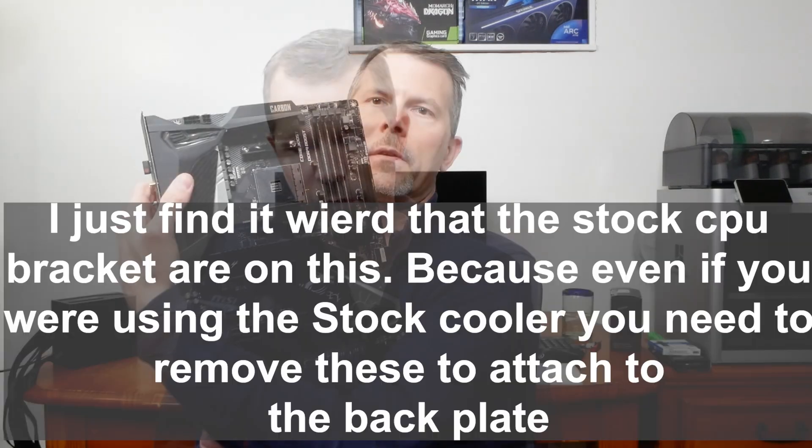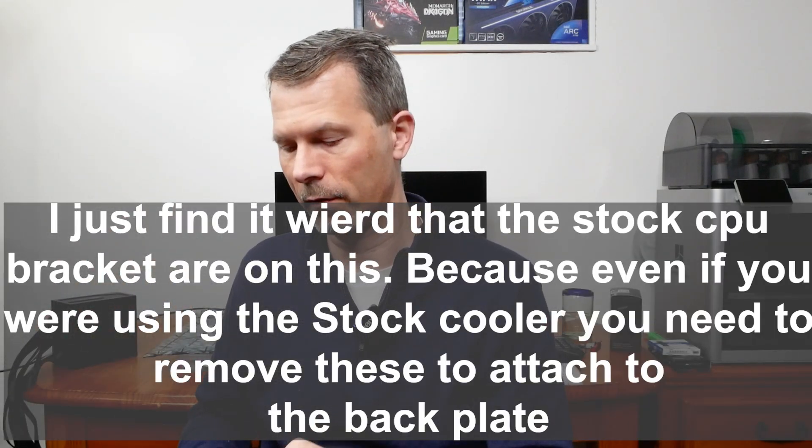In order to test this, I'm going to use an older CPU — a 3000 series, a 3200GE Pro. It's just an older quad-core Ryzen AM4 CPU, and it's like $30. If I toast it, it'll suck, but I'd rather lose that than a 5700X or a 5600G. I'm going to test it with one stick of DDR4 RAM and my Cooler Master V550 Modular Power Supply.